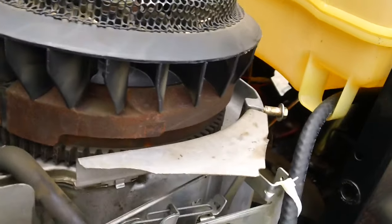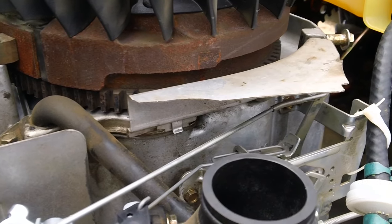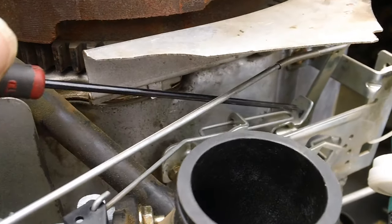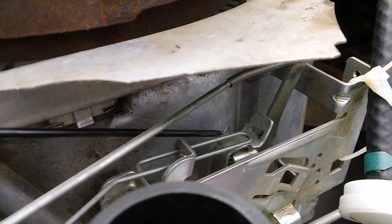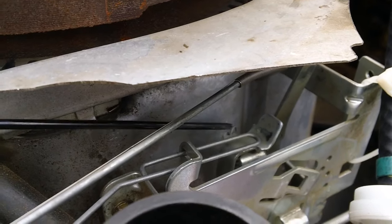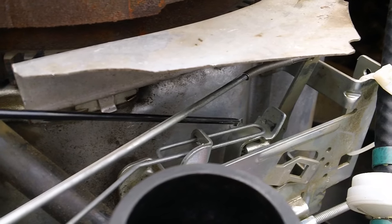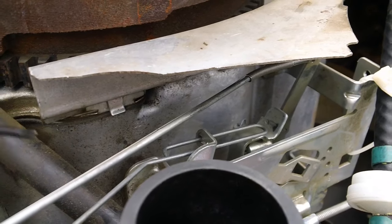So that's everything you need to know about how to adjust the RPM speed setting for the actual high-speed adjustment. Like I said, just follow your linkage back from your choke mechanism on top of your carburetor, follow the cable back to this angular piece. You'll notice on the inside right next to the engine block, you'll see a little triangular-shaped tang area sticking out. It has a spring hooked to it. You want to bend this tang arm in the up position — bend it up slightly — because you want to make small adjustments over the course of your adjustment. Do not bend it completely up, because if you do, your RPMs might go up to like 6,000 RPM and you might blow up your engine. Bend it up in very small increments over about 5 to 10 minutes while you test the machine.